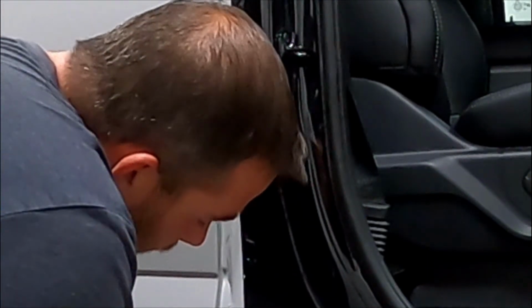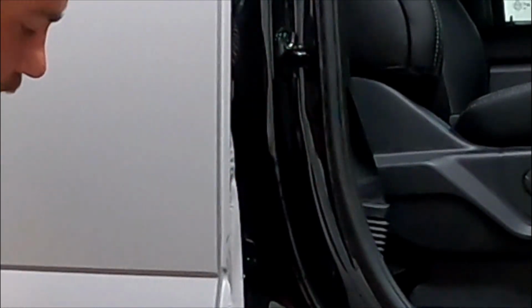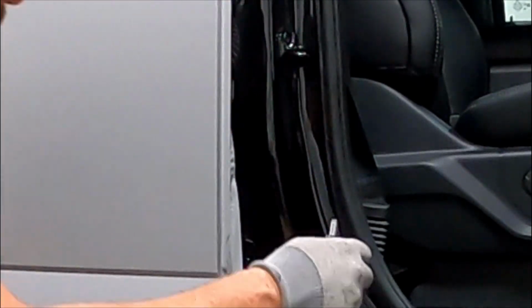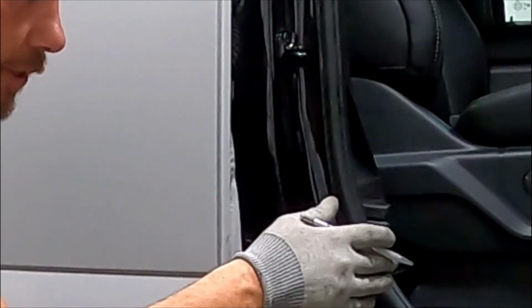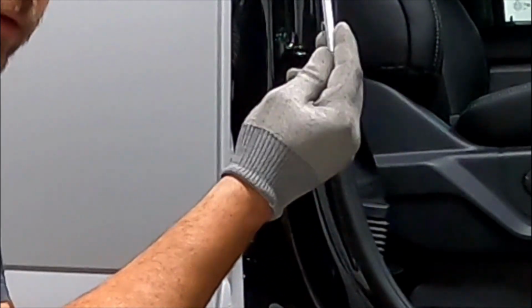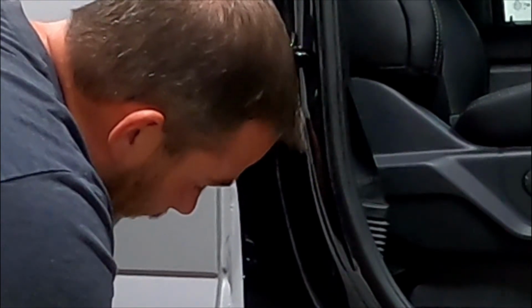And if you do find that you get a tiny little bubble in there, a great tool to have is called an air release tool. It's basically like a needle. The reason that's good is, as I told you before, vinyl will want to split, and if you use your knife blade tip, it leaves a straight line cut into it, which eventually, with heat, cool, and everything else, will want to split. A round hole won't split. It's perfectly round, no sharp edges to split down. That's the whole reason they created the air release tools.